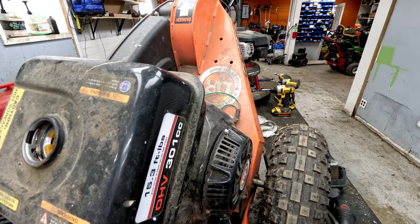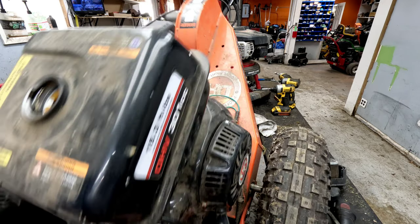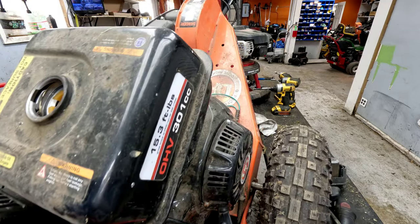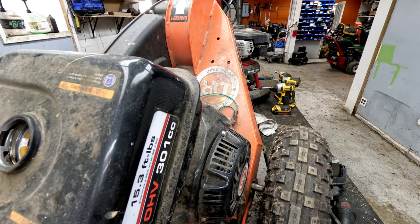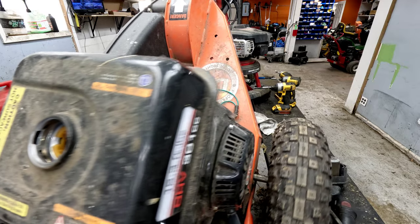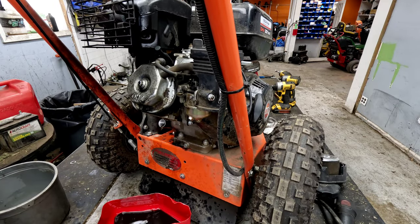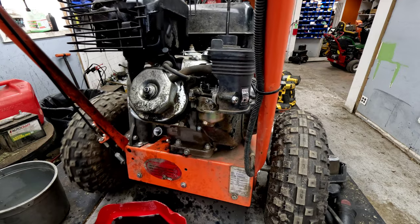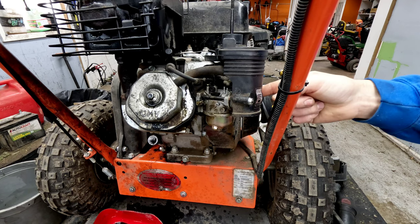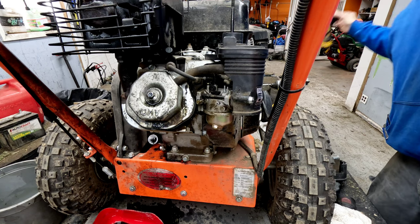And dump it back just the rest of the way real quick and see if I can't get what's left out of it. It looks pretty well empty. I'm gonna do it once again here. And we always will run these again after we get everything switched out, and then we'll drain the oil again to get any of that residual gas that we couldn't get out. I like to shake it around a little bit from side to side, see if I can't get it to slosh out there. Looks like we're pretty well empty at that point. So next the carburetor comes off here. So we do have the fuel at the off position here, so it can't drain anymore. Should have probably checked that before I went too much further.